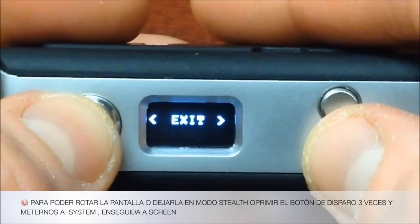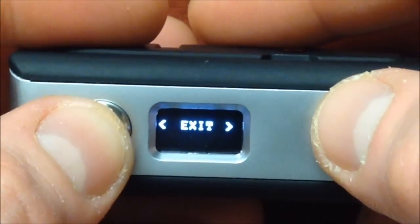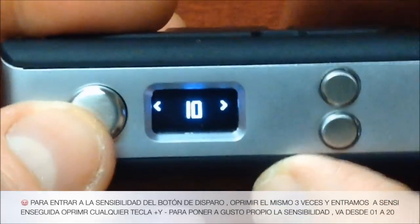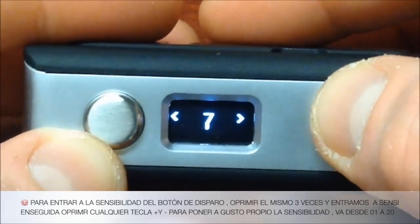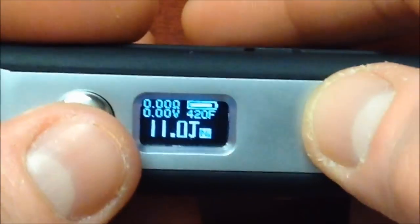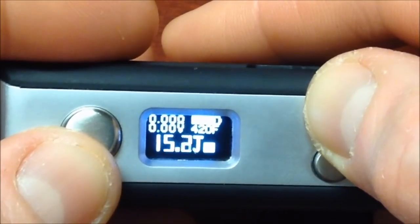The menu responds very quickly, which I liked. Back in System, there is a fire button sensitivity parameter that goes from 1 to 20. It was default at 4; I set it to 10. Setting it to Normal display mode to keep the screen on. Also, under System there's a Joules range to adjust — from 2.5 joules using the down button, it goes up to 20 joules with 0.1 increments. Holding the button reaches 20 joules very quickly.